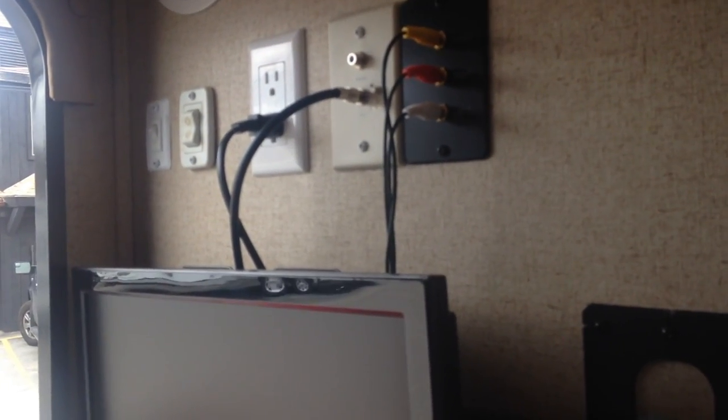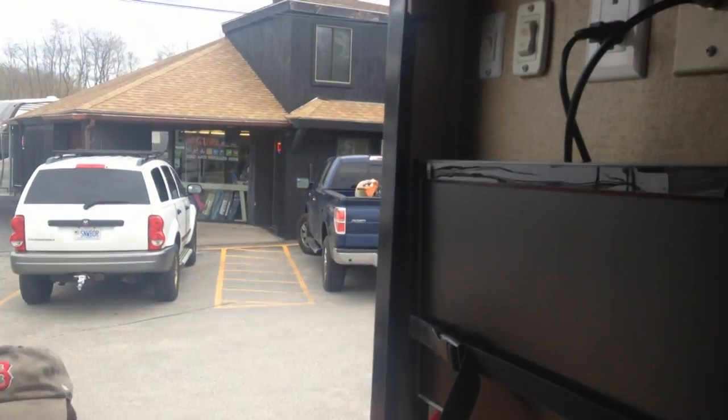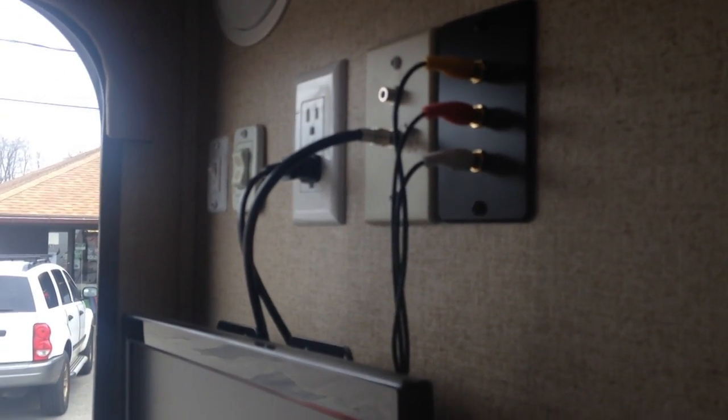A dual battery is not usually necessary — even with our big trailer we just have a single battery. The only time a second battery helps is if you're dry camping for a long time without plugging in, and especially if you run the furnace a lot since the blower fan uses a lot of power. Otherwise you should be fine. This trailer also has LED bulbs, which don't use much current, so as long as you're just using the lights you shouldn't need a second battery.